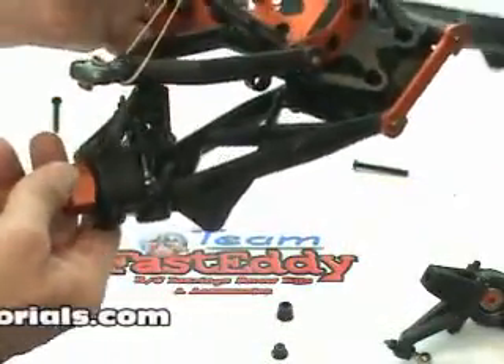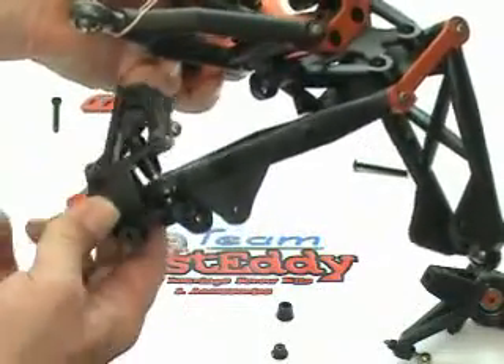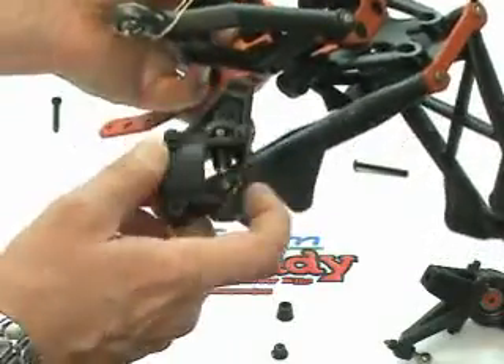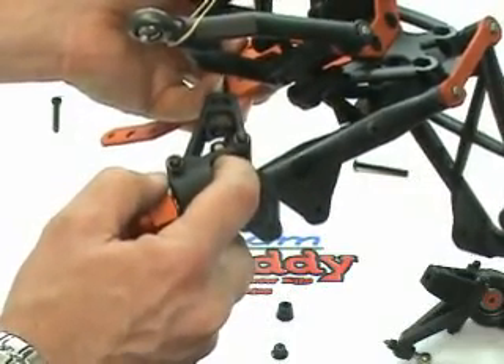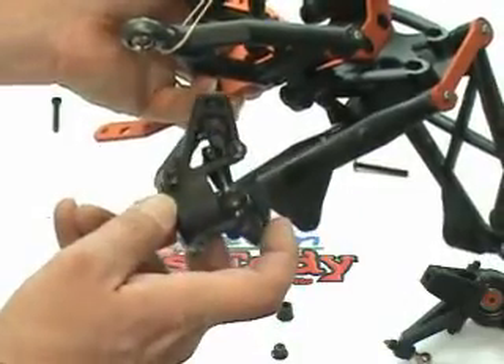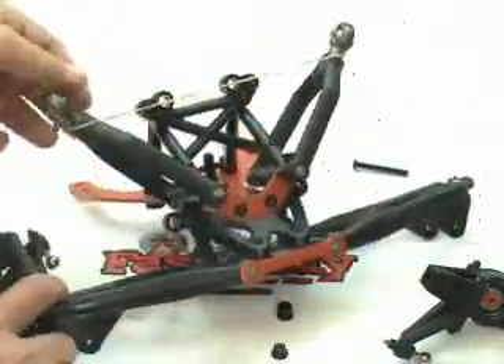This is the way it's going to look when you're done. We've put the bolt in with the A-arm going on top of the hub carrier, slid the bolt through the ball, put the cone with the small end down, slid the bolt further through, and put the nylock on. The top part is actually a lot simpler.